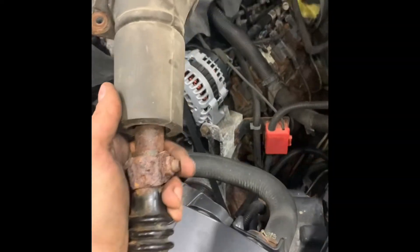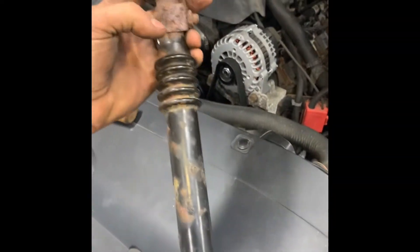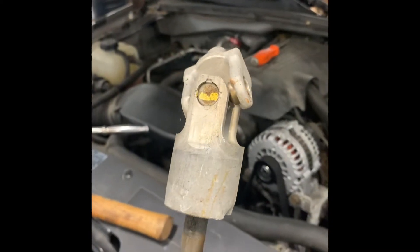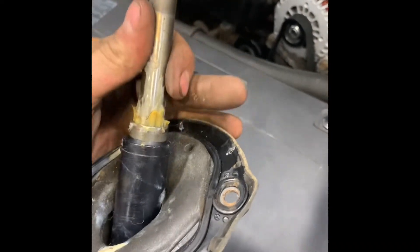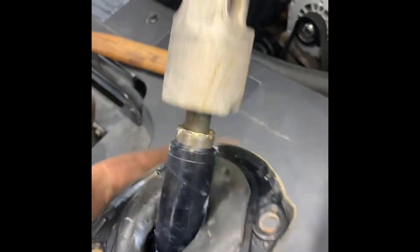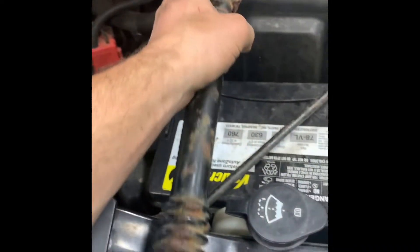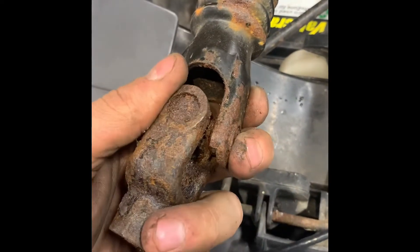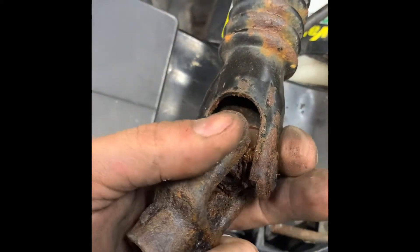It takes a little bit of maneuvering but I was able to take the whole thing out without splitting it in half. That joint wasn't so bad. A lot of times what happens is the grease in this slide dries up, gets a little play, and that'll cause noise. But what was mainly causing noise is this u-joint right here — look how crusty that is. Definitely needed replacing.